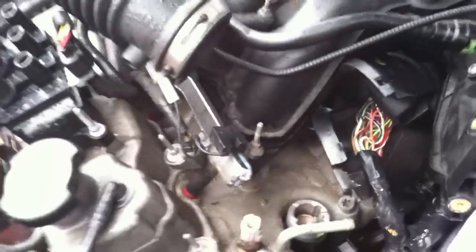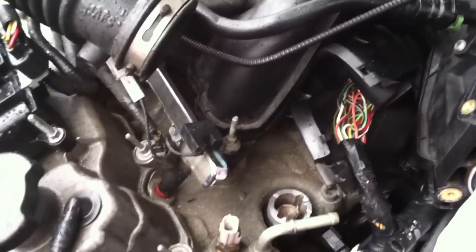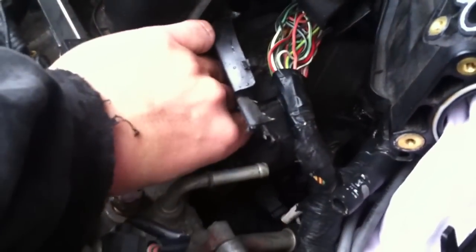So there's your reference so you don't lose timing. You take out the bolt you see on the bottom, slide this out, the whole assembly will rotate, and then you won't lose the timing when you go to replace the old synchronizer. The thing I just found that was easier is getting this engine to top dead center and then having the alignment tool line up, so I could be sure I'm not going to lose engine timing.